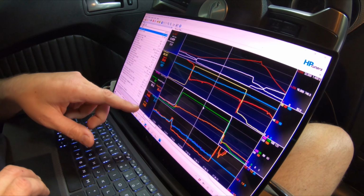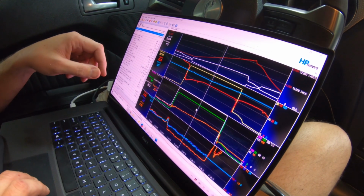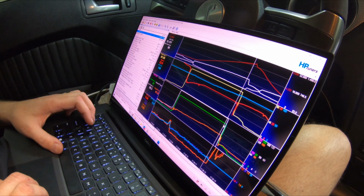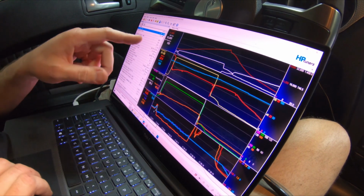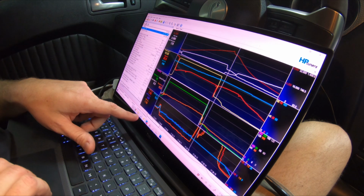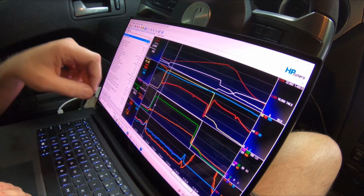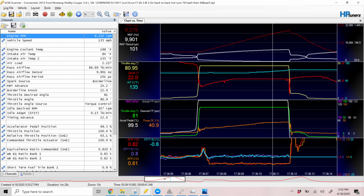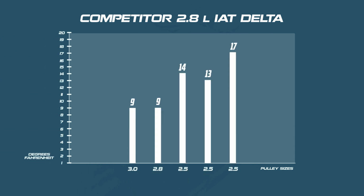So this would be our second back-to-back run. See, timing's at 22. Air fuel's good at 0.82 lambda. Air temps 127 rising to 140. And then if we switch down here back to the second pull, all right, let me give you some time indices. This run was completed at 42 seconds, and this next run was started at 1 minute and 8 seconds. So we start our downstream at 146 and we finish at 163. The tune is at 22, but is finally set to pull timing with the air temps going over 160. The timing drops to 20 degrees, and we are at 698 rear wheel horsepower.